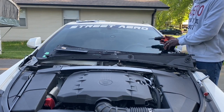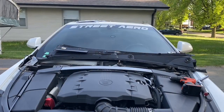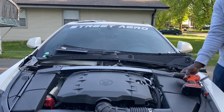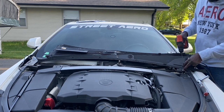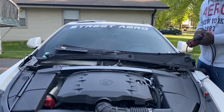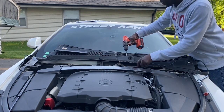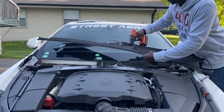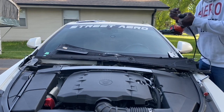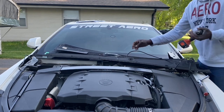That's number two. So I'm gonna get the tubing and check to see if I made it big enough, and hone it out a little bigger if need be. And here's the tubing. It's a little too small, so since I don't have the correct size drill bit with me, I'm gonna make it a little bigger. Going like that. Perfect. Perfect again, nice tight fit.